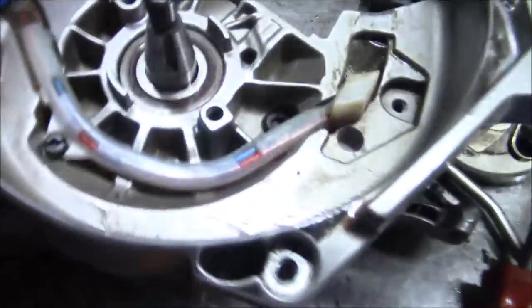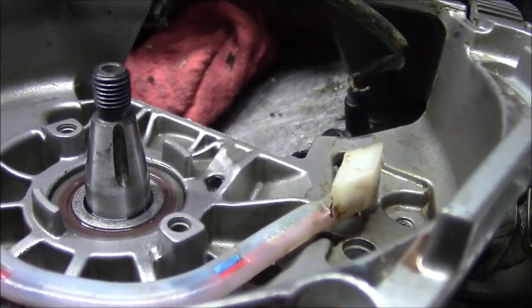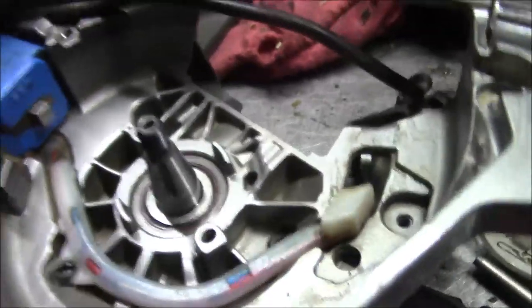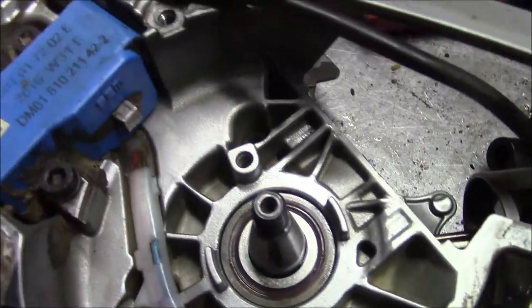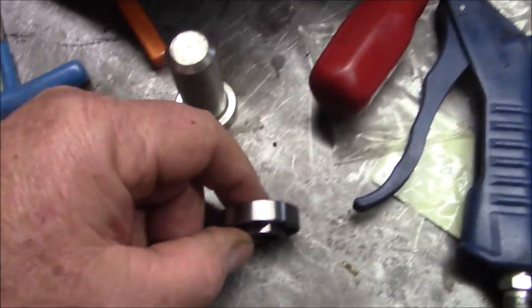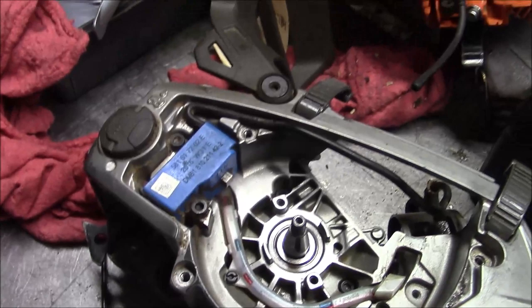It looks to me like there's more protrusion of the inner race of the bearing with this new seal than the old one. And that being the inner race, there's more seal tension, so there was a change by putting that seal in there.